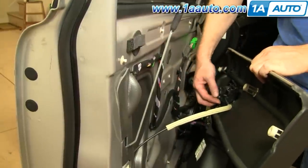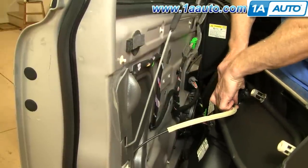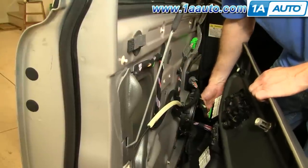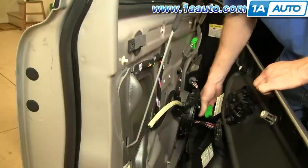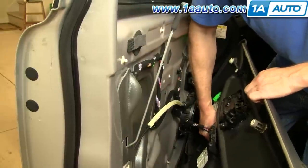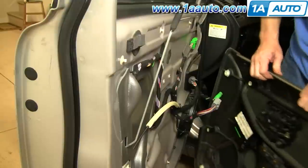Once you bring your door panel out a little bit, you have your door handle cable — just kind of separate a couple little clips and pull out on that a little bit. It comes right out. Then there are two connections. This green one has buttons in behind — just reach your finger right in behind, right in the center of this green one, and it pulls out. There's also a gray one back here — same thing. Feel for a little button, push the button, and work the connector out. Here's the connector, here's the button, and your door panel comes off.